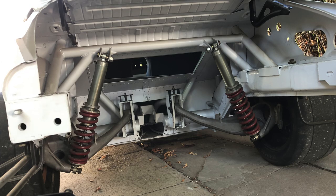This chassis, as you can see here, was already cored out and can accommodate a direct bolt-in of a Porsche G50 transmission. Now my G96 doesn't mount the same way, and I have to figure out how to modify what's already there. But the plan is to get the car up on jack stands, get it level, slide the engine and transmission underneath, line up the axles so they are in line with the wheels.